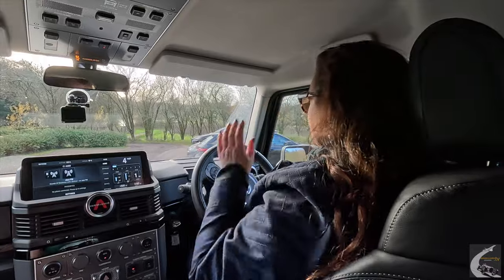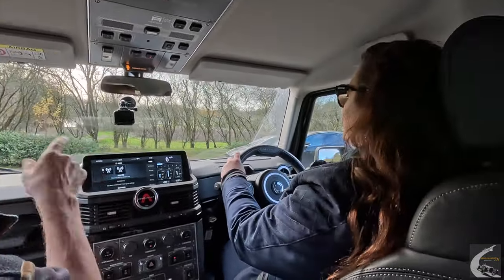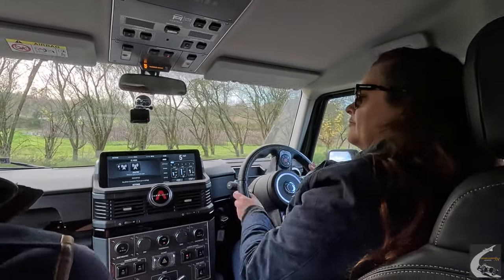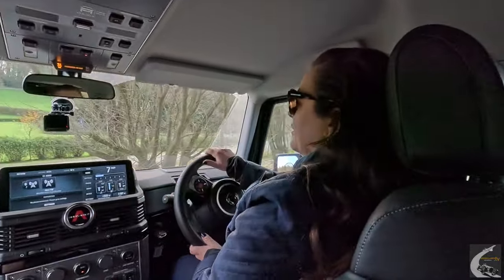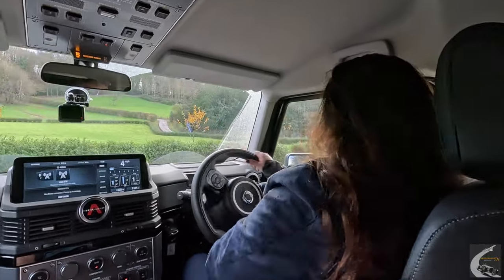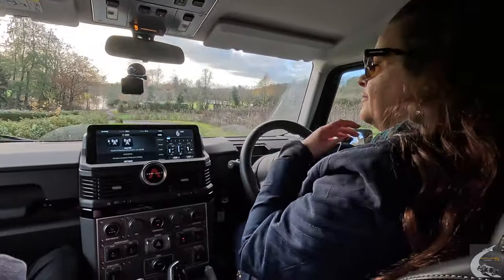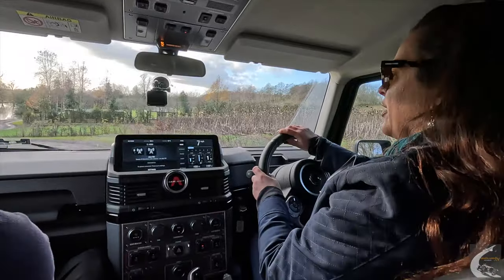We had some sunshine just now, that's it. Now, the steering's quite low geared, so you'll need to get the steering on early to get round bends and things. Okay. And you seem to put a lot of steering turns in. Yeah. So, and then back it, and what you'll need to do is feed it off again as well. So, it's not as prompt self-centering as something like a rack and pinion. So it's because it's a steering box on this one, recirculating ball.